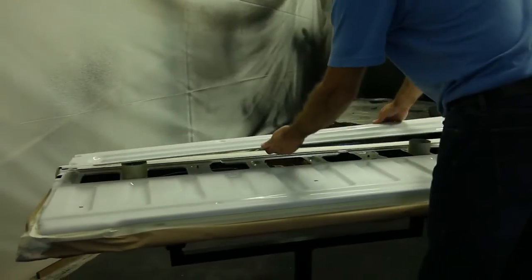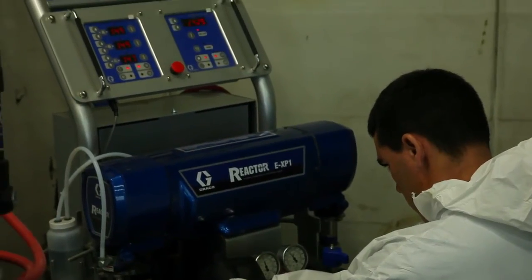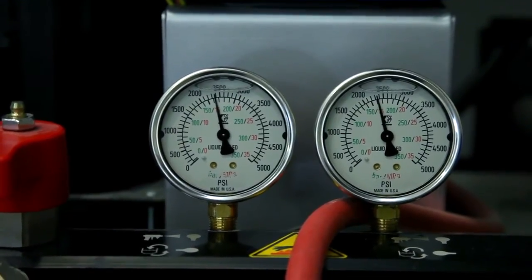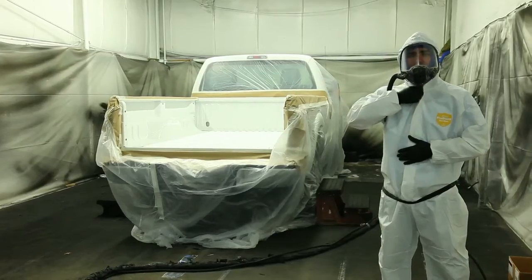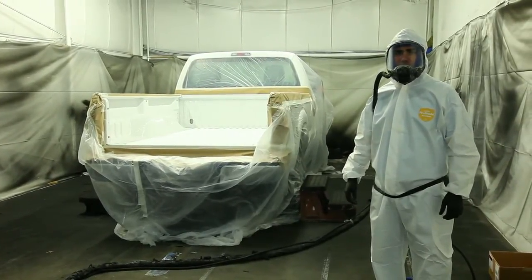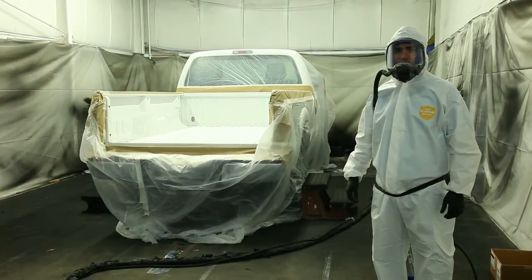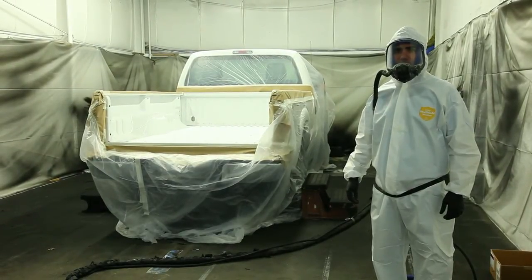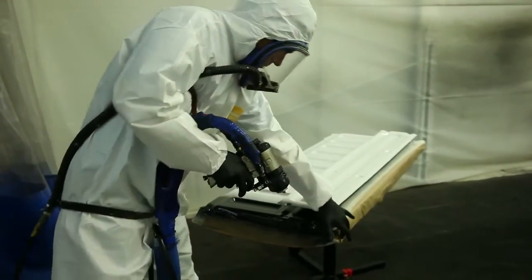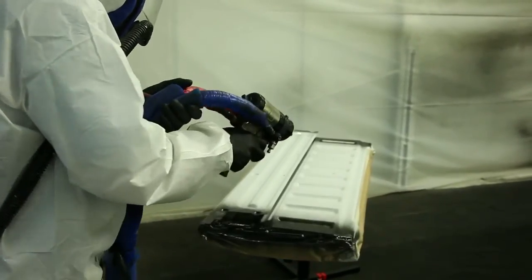Make sure the access cover is in its position and raised up on blocks. Check your equipment, making sure it is in good working order, and check the pressure on the machine. Prior to spraying, it is important that you are wearing protective clothing as well as a full face mask and gloves. Your gloves should fit properly and tight with your sleeves. Starting with the tailgate, spray several short blasts of the Rhino Linings material to coat the wire trim edges on the tailgate for a nice even coating.